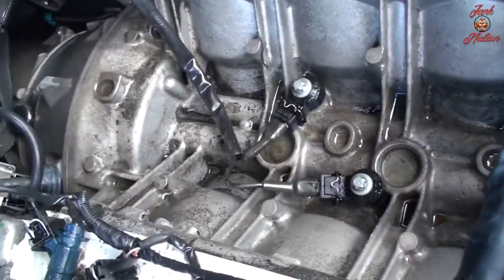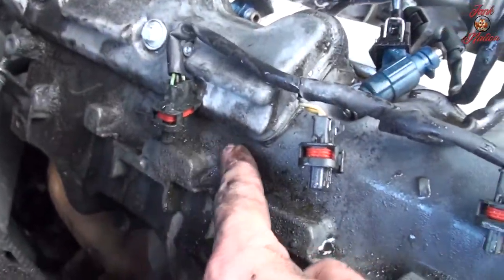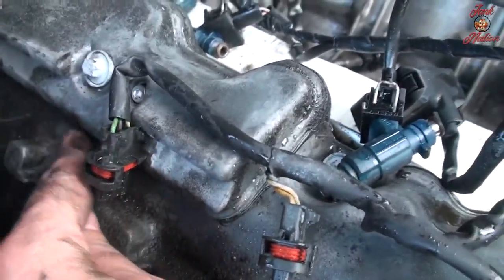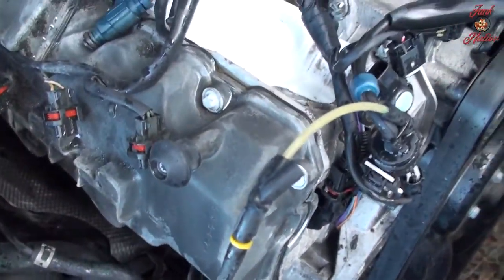Pretty good. That's acceptable, I think. Cleaned it up pretty well. So here's what leads me to believe that it's leaky breathers. This is the breather here, and you see all this residue basically fall out from this seam right here. So I believe that would be the majority of my oil leak. I'm going to find that out in conjunction with the valve cover gaskets.